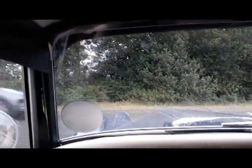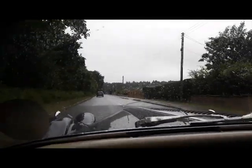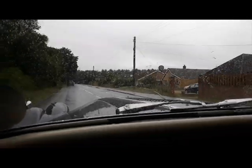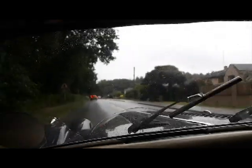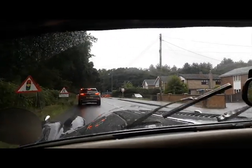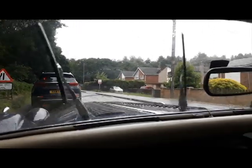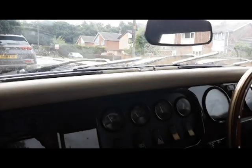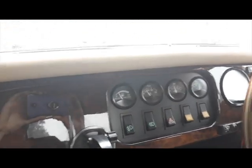The Piper 270 camshaft has really made this interesting and fun to drive in the mid-rev range. We'll definitely be taking it steady today because the road's definitely moist. But steady is one thing this car does very, very well still, even with the upgraded camshaft. Although it's only the 270, which is our mid-range camshaft — we also use a 285 which is slightly higher lift. All of our camshafts have excellent idling characteristics, and we still allow the cars to pull fifth gear from about 15 to 18 miles an hour upwards.